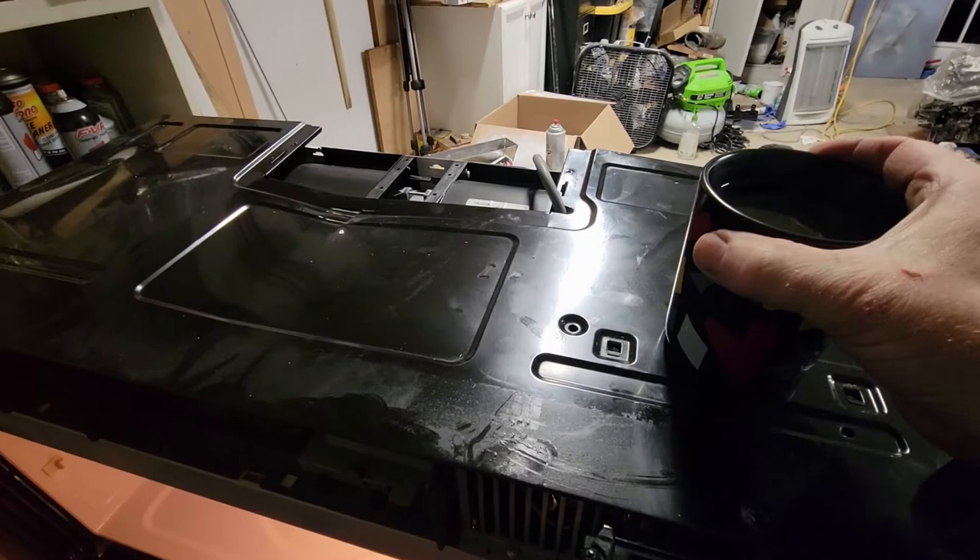What have we learned today? We learned how to fix the microwave. I replaced the fuse, but more importantly I exercised all my connectors — just hit the clip and moved them in and out — and then I replaced the interlock switches. All the door switches get replaced. That's pretty much what that sticker was saying: if the fuse blows, replace the switches, and replace the fuse as well. This microwave is good to go. Of course, this is only an instantaneous test, but it heats water so it's good to go. I'll button it up, test it a couple more times, and maybe give it away on Facebook Marketplace. Enjoy the journey — you can do it. Thanks for watching.